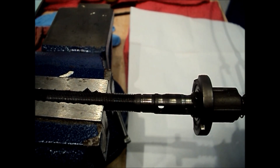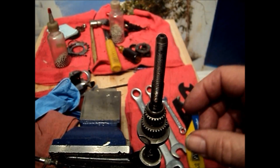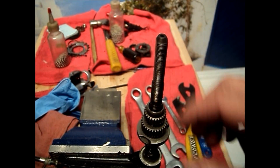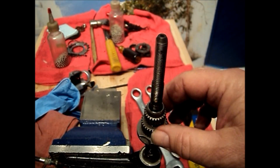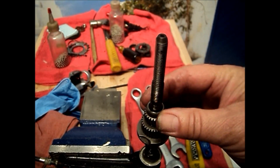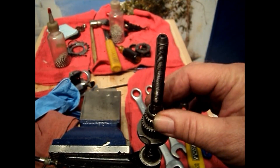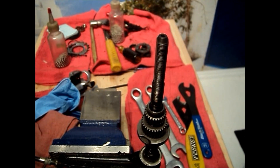So that's how the ball lock technology works. Now we'll be putting the sun gears in the planet carrier. It's very important that you take note of which direction the sun gears face, and getting them on there without losing the three locking balls can be a little tricky. There's also a spring that goes between the two sun gears — it's very important that that spring go back in place.